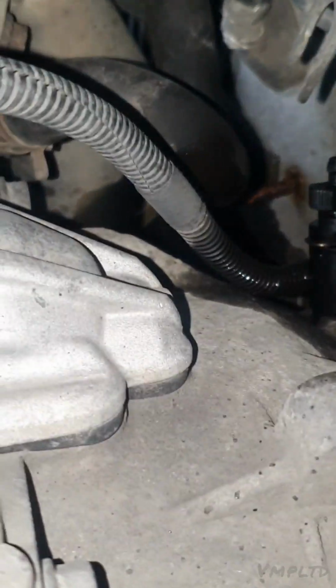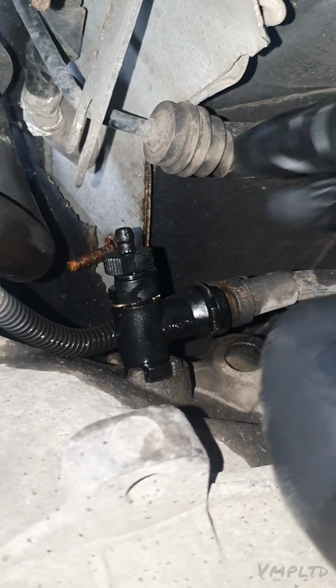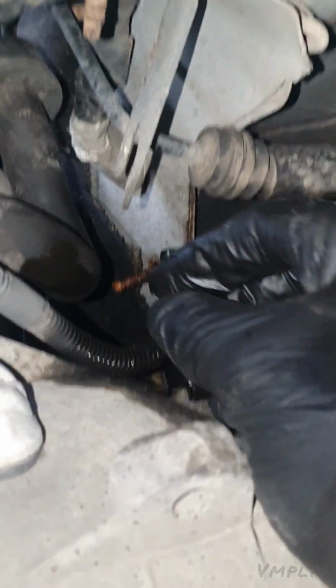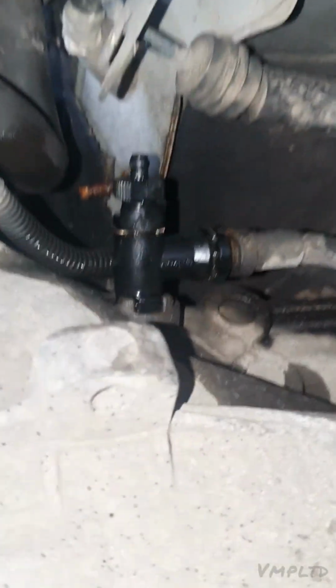Make sure you don't leave it open whilst the system is not pressurized. Once you've locked it tight, then you can release the pressure from the bleeder, and that should bleed your van. Even if you've got any issues in terms of having to bleed the clutch, that is how it's done. If you want to get this job done correctly, that is what you'll need to do. I may grab some visuals as we're getting it done, but instruction wise, I hope that's helpful.